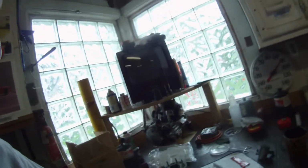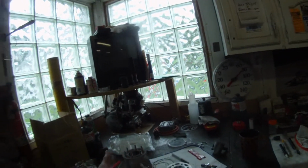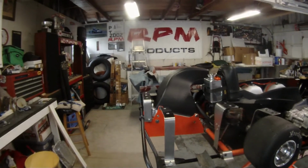I think what we're going to find here is that this cylinder, and I can measure it on the top where there's no aluminum, I think we're going to find that with a 53.96 piston that measures 53.96, we're going to end up with about 1.5 thou of clearance, and that's obviously not enough, which would explain why it took 3 putt-putt laps for this thing to get up enough temperature to shut itself off. Were we bummed out? Yeah, we were absolutely bummed out that all the work that we did here, we never really got to prove out.